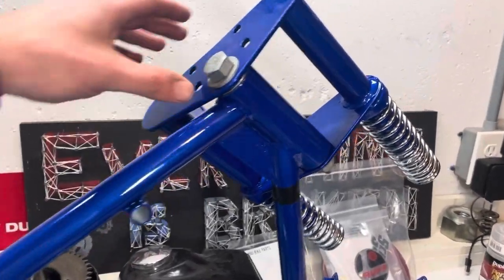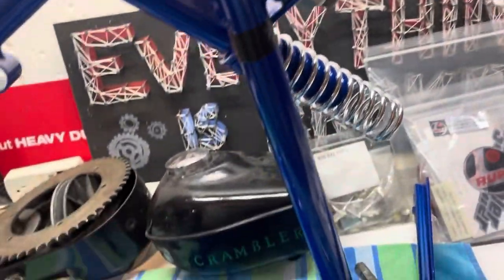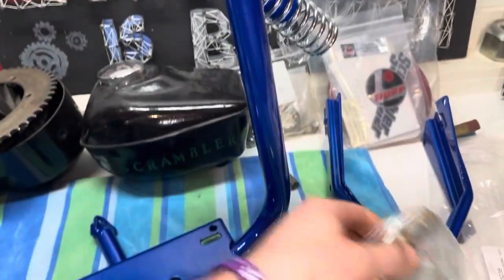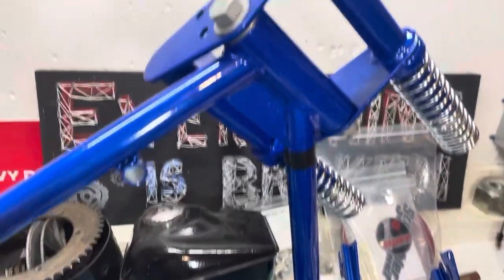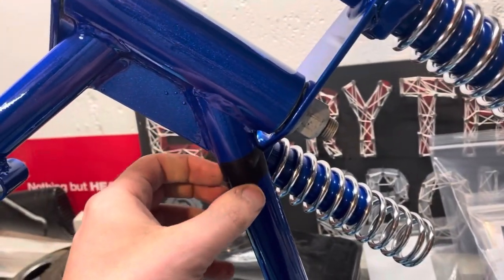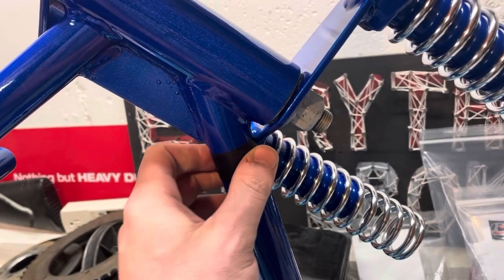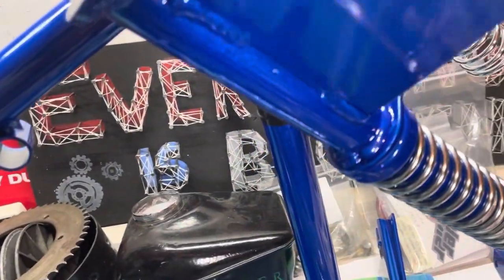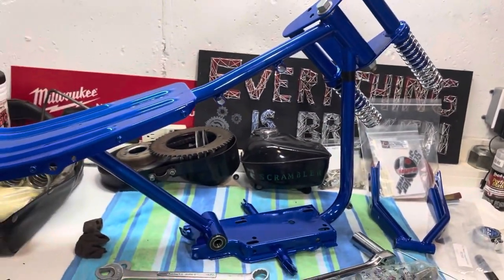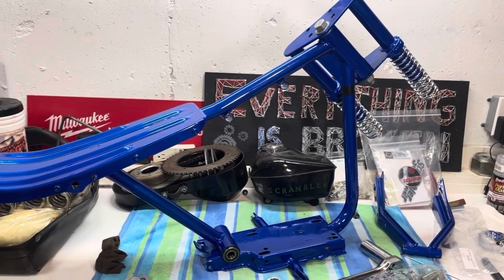I got the front fork on — new bolt, new nut and washers. Nice and tight. It used to wobble up and down because the old bolt's threads were all chewed up; it was riding on the threads. I wanted to go with a stronger bolt, so I did a grade 9 — it should be nice and sturdy. I've got some tape covering the frame where it's hitting itself so I don't get any chipping. There are still some dents in the frame — newer models have a weld to prevent that. But making progress, and that's all I'm doing for this video. I've got some things coming up this week I need to tackle first, but I'll get back to this project. Thanks for watching.